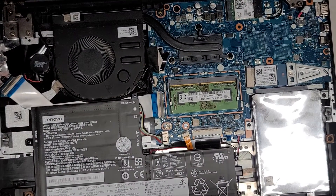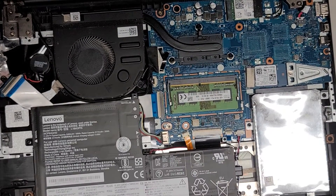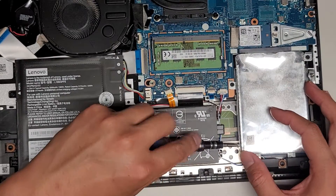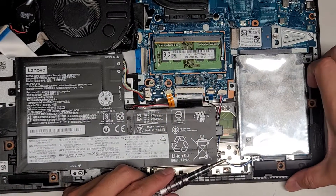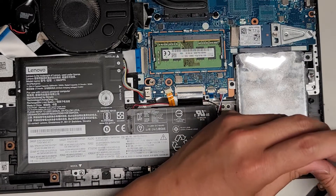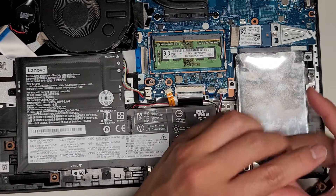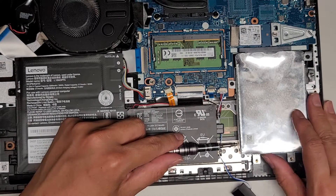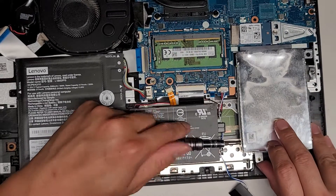Here's the missing screw — that might have actually caused it to damage itself. The screw from the hard drive bracket looks like it just came out on its own and was stuck under there. That might be what fried the motherboard. I would say that could be considered bad manufacturing, because they should put something to prevent the screw from coming out like that. Normally they put blue threadlocker on random screws to help hold them in place.